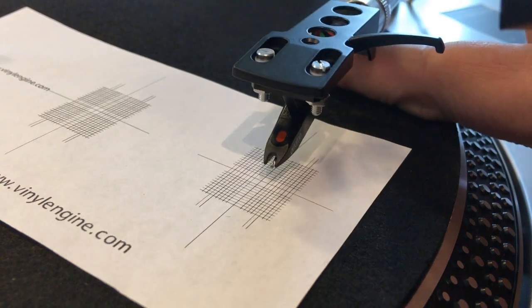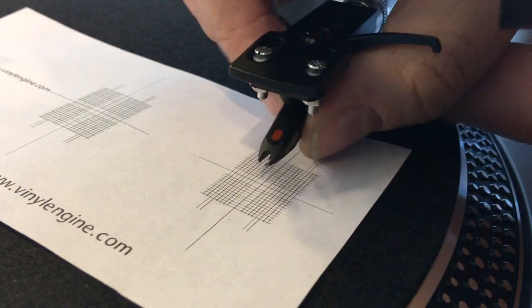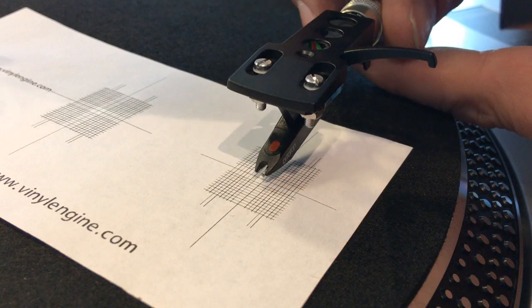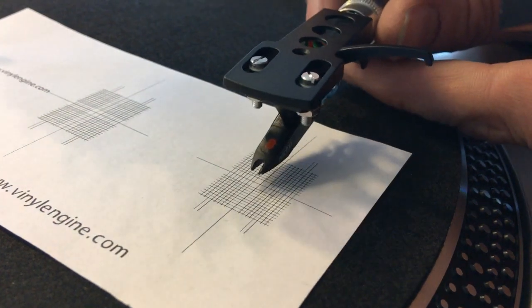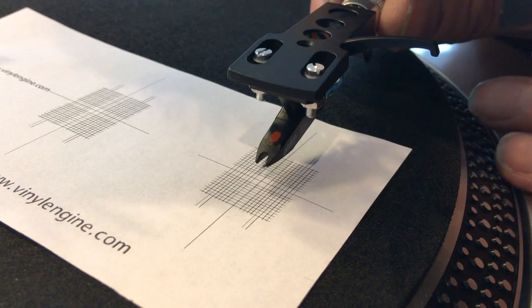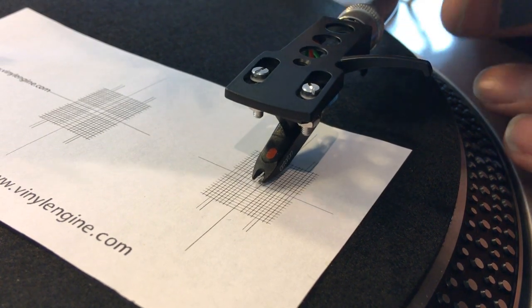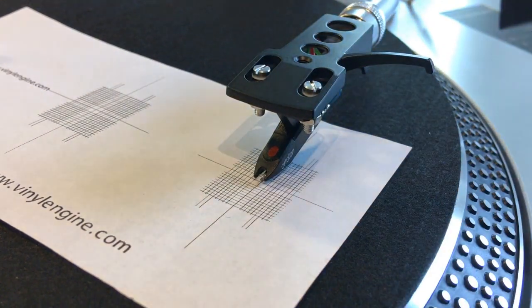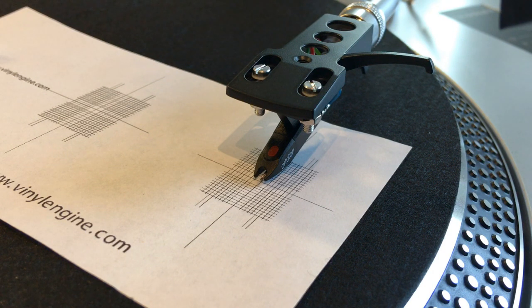Earlier, we should have had the stylus protector on — I can just hear the comments now. I'm looking top down, trying to find that point there. It's tough because the head shell itself — you can't align that. You can only align the stylus and the cartridge. Gosh, it's hard to do with shaking hands. This is not great to do with your stylus. Again, that's why you want a pre-aligned one. Okay, that's pretty close. Looking from the front, it's better, but not quite there. I'm going to go ahead and make the adjustment so you don't just sit and watch me shake for five minutes. I got it as close as I could.